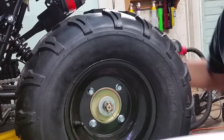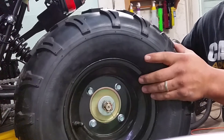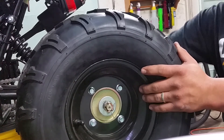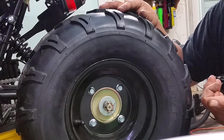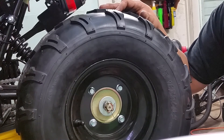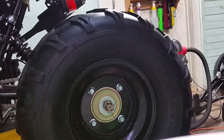It's pretty much assembling the whole rear end. Now I have to adjust the rear axle and the chain as well. I'll do that on the floor that way I have the weight of the vehicle — the quad — and have less issues with the chain. I don't want it too tight; I want it kind of snug loose.